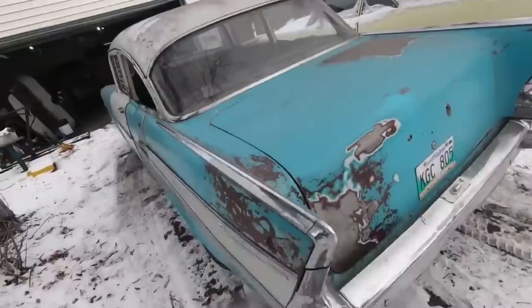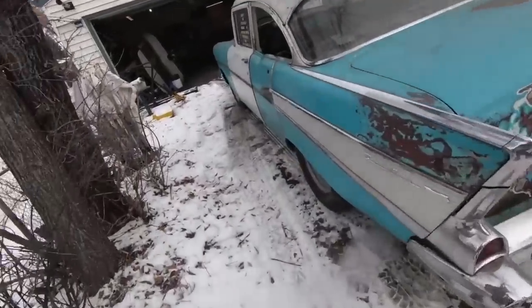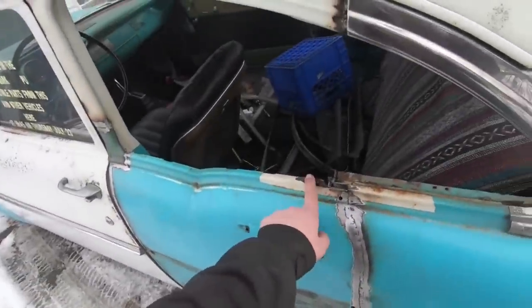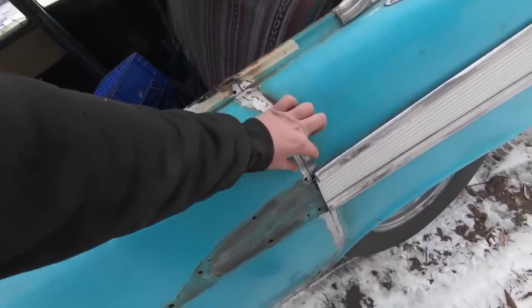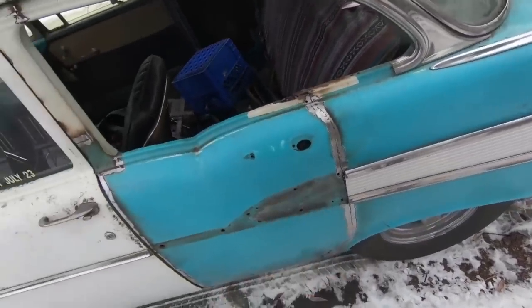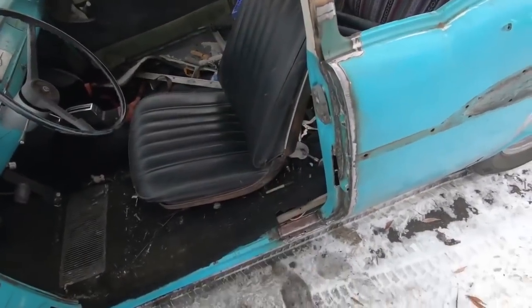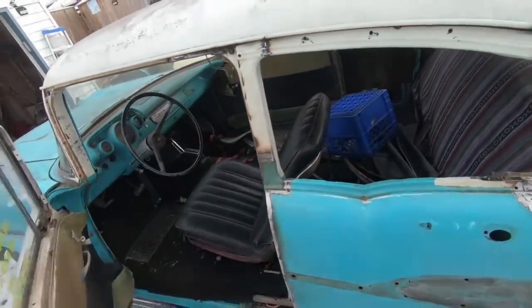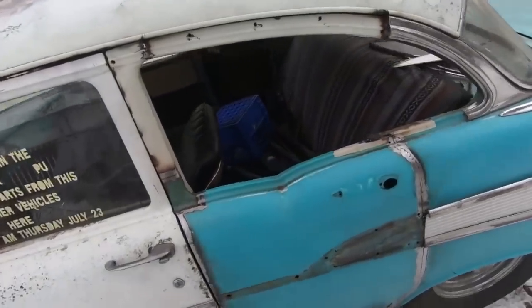So just kind of a little intro there to this video. I'll put the car back in the garage once I get it cleaned up a little bit, and I'm going to start welding up the little holes and fixing up in here. Then as little filler and bodywork as I can do in that little strip, all the way down around and back up. I've got some work to do on the jam too — but you don't see them when the door's closed so who cares, right? I'll be getting going on that — it'll be a bit of bodywork.